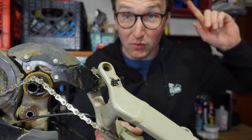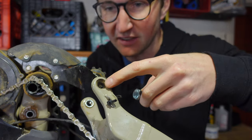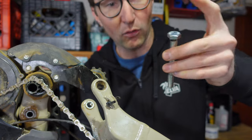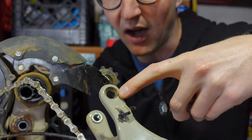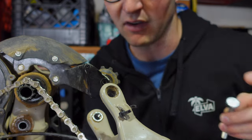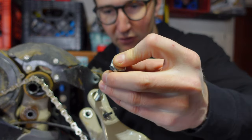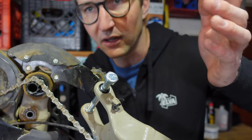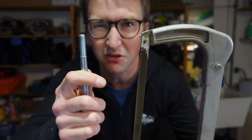That's it. Now I can show you why I went through all that hassle. The chainstay is shaped like the end of the old bolt, and I don't want to put this flat head bolt in here and have all the force on the outer surface of the chainstay pivot area. So we can put this through and it will now distribute the load while the Lowe's bolt holds the whole thing in tension. The last thing I'll have to do is just cut this to length — it's a bit too long.